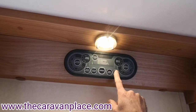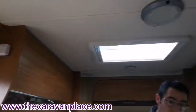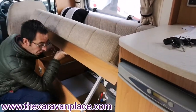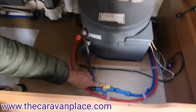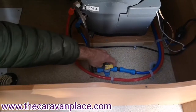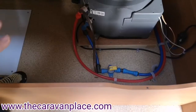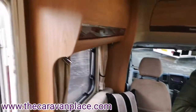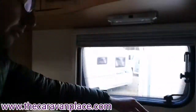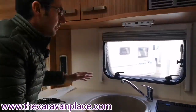We've then got our cabin light and our water pump on/off. Before we put our water pump on there are a couple of things we need to do: make sure we've got enough water in the system, make sure our taps are all in the closed position. Just underneath this seat here we've also got another drain-off valve - the little yellow switch - which is for the water supply for our tank and tap system. When we want to drain this off we pop it into the upright position and open all of our taps, but when we come back in we need to make sure this is back flat and all taps are closed before we put the water pump on.